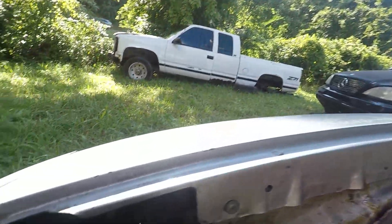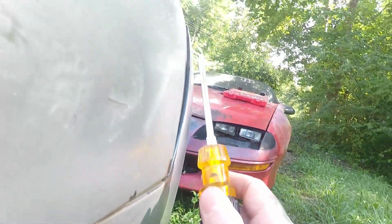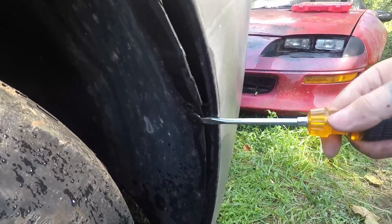We got the nut on this side. Now we come down on the fender well — there are clips here, here, and here that we need to remove. You also need to remove the clip on both sides, and there might be another clip over here so you can move the fender well out of the way. There should be a bolt up here on both sides — this one does not have it.